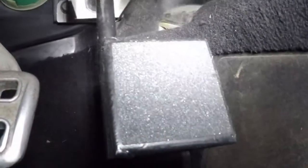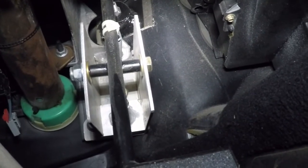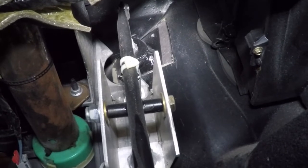That's probably the most difficult one because you have the steering column and the brake pedal bracket back in there — there's a lot of stuff in there. I unhooked the steering sensor right there, that little gray connector — just grab it, pinch it together, and pull it out. While I'm down here, I'll show you this because I'm kind of proud of it — that little thing right there is my throttle pedal. That looks different than a factory one, and you would be right. That is the drive-by cable pedal that I make for a C5 Corvette. If you need one, give me a shout.